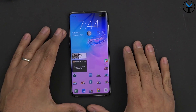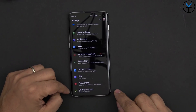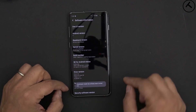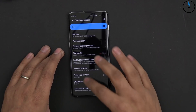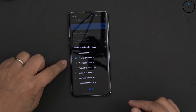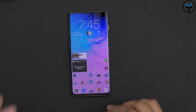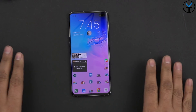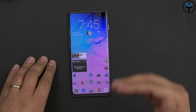Some things we can do to speed up our device: if you're using the stock launcher and want to speed things up, go into Developer Options. To turn this on, go into the software tab and keep pressing the build number until you see 'developer option is on' or 'you are a developer.' Turning on Developer Options does not damage your device and you can turn it off anytime. The reason to turn it on is to control how fast system animations run. Our device is normally set at 1x speed — if you run them at 0.5x, the system will be a lot snappier, everything will load faster, and you'll notice a pickup in speed.